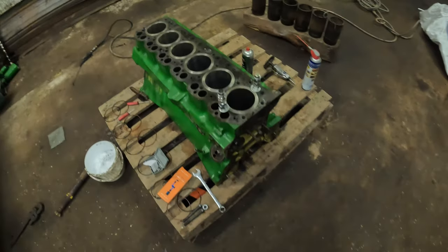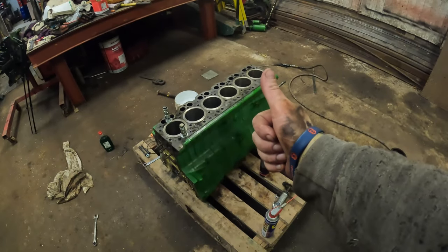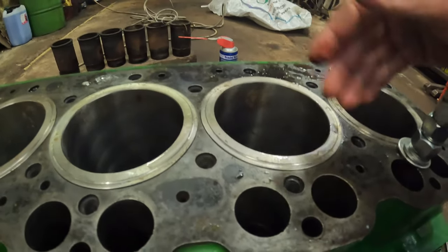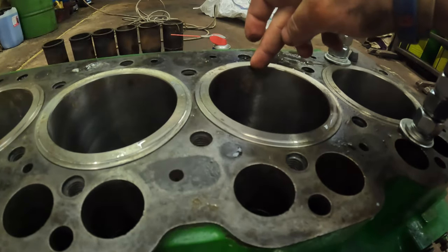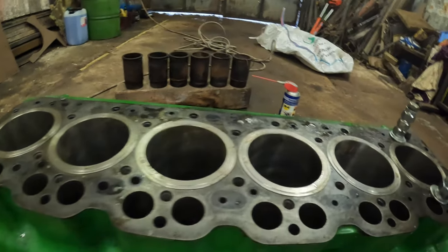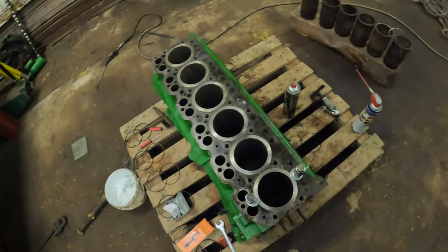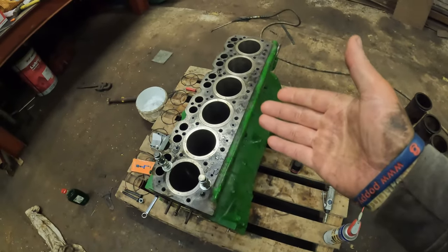I think that might be the end of the video - thanks for watching. But before I go, remember when you're measuring it, measure in each corner - like at each bolt hole position, all four of them - and just take an average measurement from all four of those, and then take an average between the six liners. So you've got an average across the board. Because it's got to be within 0.02 to 0.10mm all the way across. It took me nearly all day to do that. I'm knackered and very cold but it is done, which is marvellous. Hopefully we won't have any problems. Goodbye.